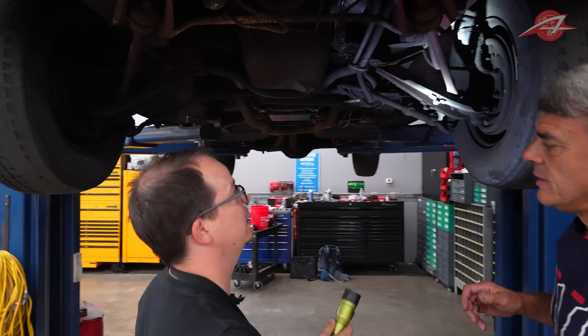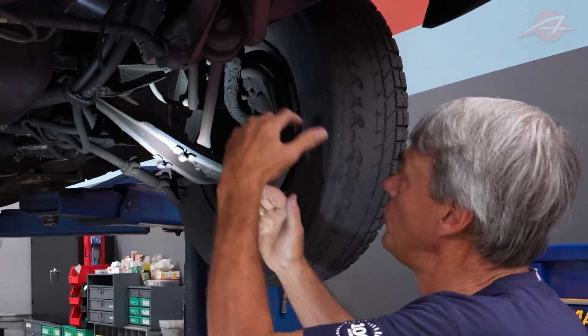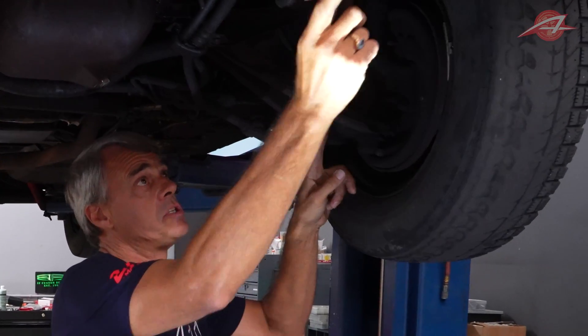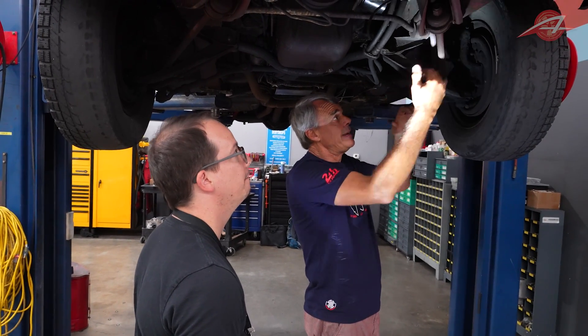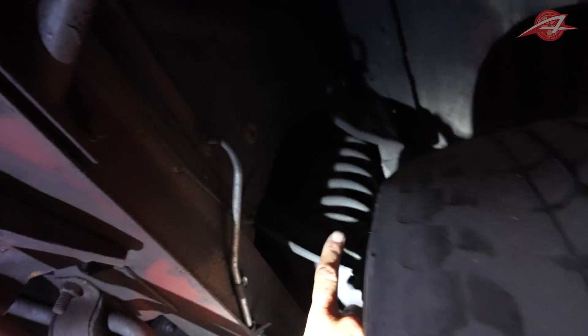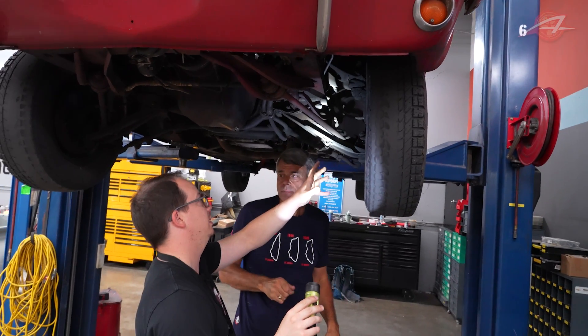Let's look at the front, because if you've worked on modern suspensions you'd look at this and there'd be a lot of weird stuff — it's not obvious how it all works. In concept, this is actually very similar to a modern double wishbone suspension. You have what's functioning as a lower wishbone, but it's made out of two pieces: this lateral link right here, and this bar that is solidly bolted to it going to these bushings in the front. The bending in the bar notwithstanding, it all acts as a rigid structure — you basically have an A-arm, a lower wishbone, made out of these two pieces. Then on the top you have a more traditional stamped upper arm, and the two of them together form a double wishbone.